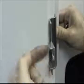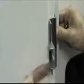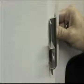Discard two of the metal spacers. Place the bracket against the rear door to ensure proper alignment. Due to some of the inconsistencies in the sheet metal, you may need to flatten the surface for the bracket alignment.